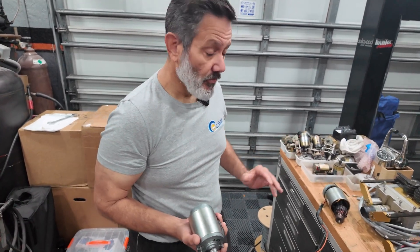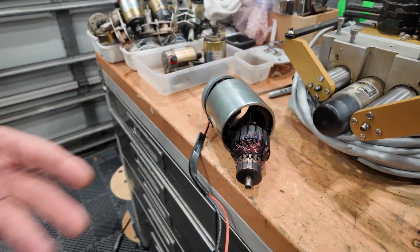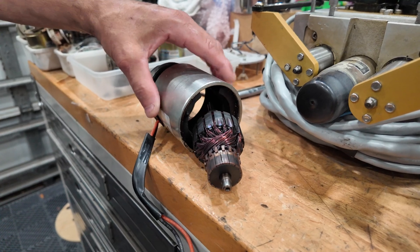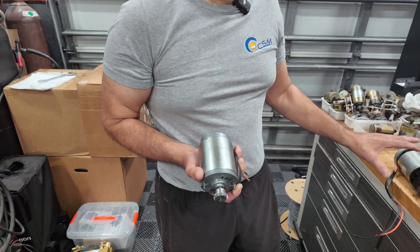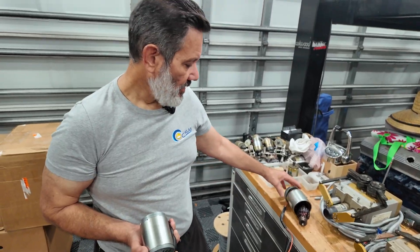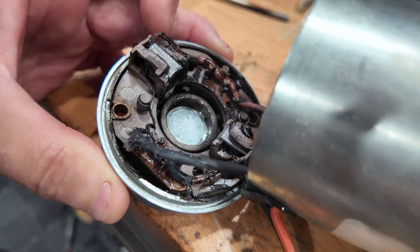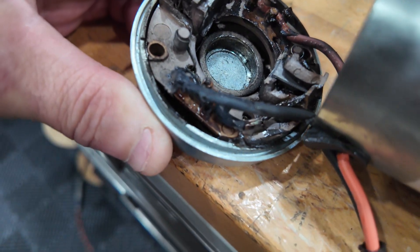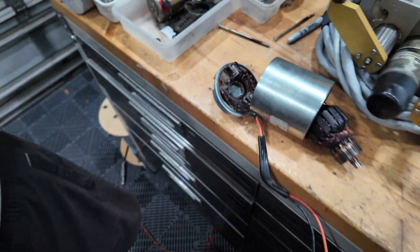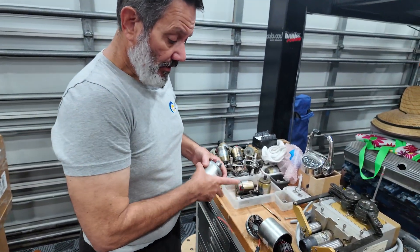The first thing we need to start off with: I get people to send me things like this and ask what do they need to do. We don't even go that far — we just tell them to purchase a brand new motor. If we opened it up we could probably tinker around, but as you can see, the customer overloaded it and melted all the brushes. There's nothing we can do to repair that — it's completely garbage.